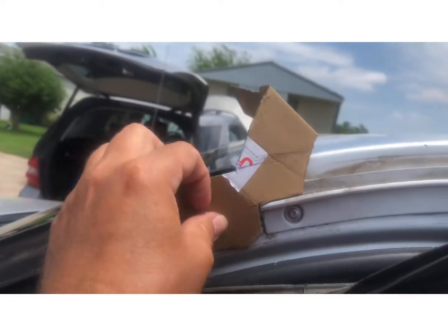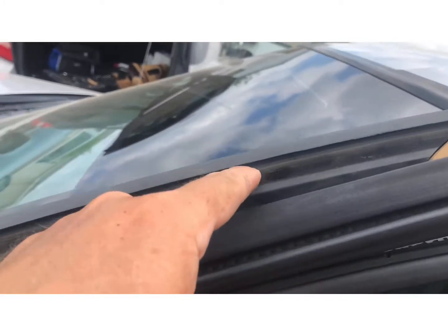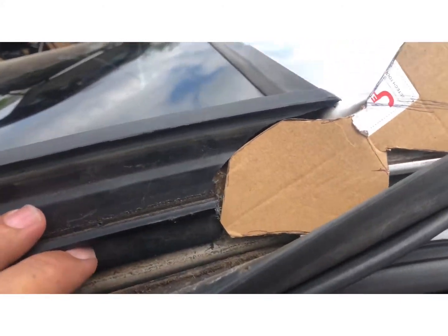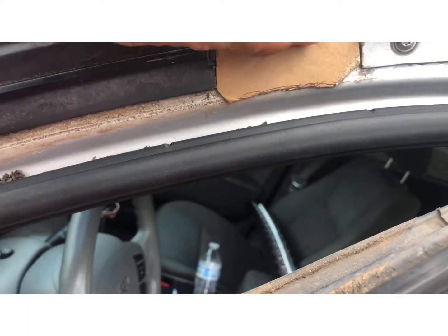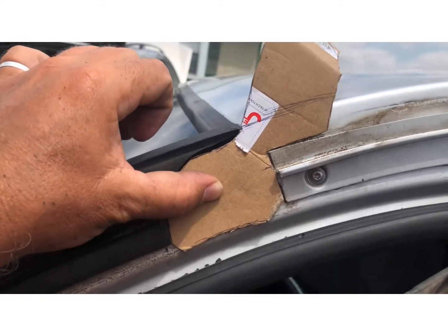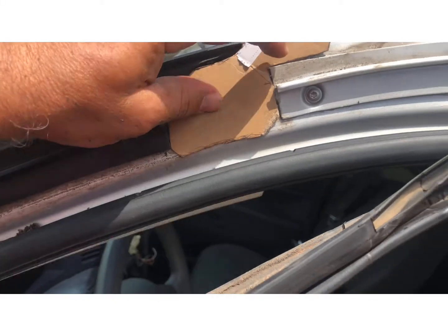This will fit in here and that bracket will hold the light later. The template for this light bar bracket is almost done. You need to pull off this trim around the windshield — pull out a couple screws — and it needs to be cut out so that your bracket can mount inside there where you want it to be mounted. Now this thing is ready to cut out a rough metal bracket. I'll need to cut out two of them, one for each side, then take off the other side trim piece and cut it to make that fit.